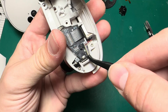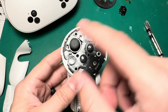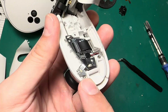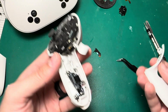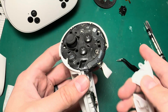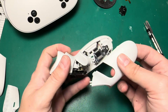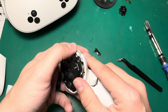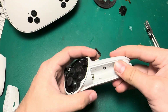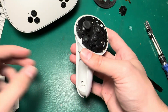Next is our haptic feedback cable. One thing that's interesting to me about the Quest 3 and Quest 3S controller design: unlike the Quest 2 with its halo ring and LEDs that go around that, the Quest 3S and Quest 3 controller actually have one LED tracking diode in the handle, which seems like it should help the tracking a lot — even though anecdotally people seem to feel like the Quest 2 controllers track better. I'm not sure if that's just because they're used to them or if that's genuine. Now we're going to put the inside grip portion on — I'm looking for this tab to seat first, and then we need to get this ring hooked around that eyelet, underneath the board. They really are a lot like little wooden box puzzles — when you know how to line them up, they line up.